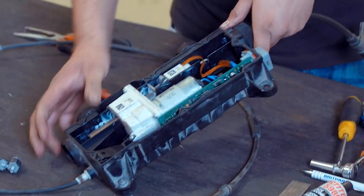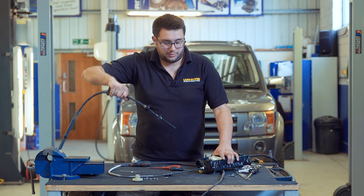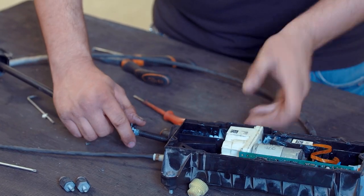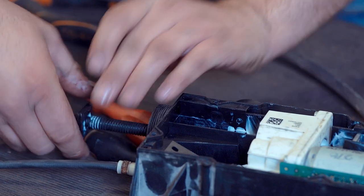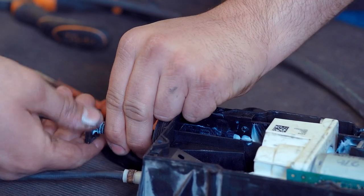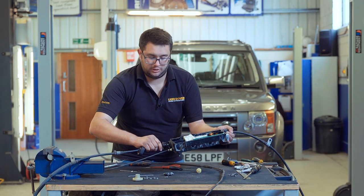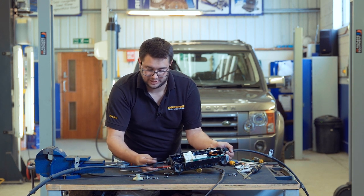Finish tightening this and then we can move on to the other side. This is a threaded cable — we need to thread this into the pull five turns. Don't forget it's a left-handed thread, so you're essentially turning it anti-clockwise to tighten it up. Feed it in through the side of the module, get it started, and then turn one, two, three, four, five turns. Once that's latched in, take the plastic collar and push it into the side of the park brake module, making sure the pin lines up — it should sit flush.